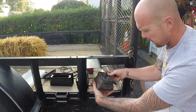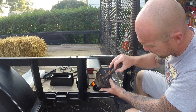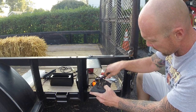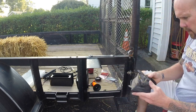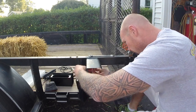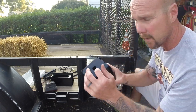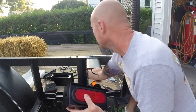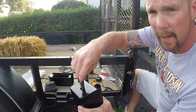I'll take and cut the wiring off the back of the old light. It's marked: yellow is stop and turn, and brown is your tail. I'll cut that off and leave a little bit within the housing so we know which wire is which. The new wire will be coming in through the side of the box. I forgot to pick up a three-quarter inch grommet, so I'm just going to shove the wire through some hose and tape it on both ends so it won't ride on the sharp metal edge.